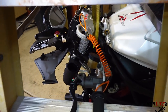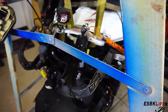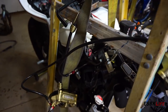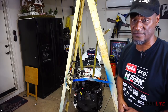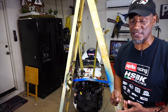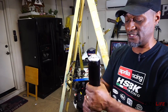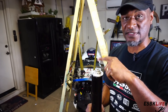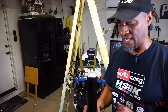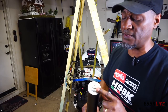As you can see, the forks and everything are already off the bike — the clip-ons, wheels, tires, all of that is out of the way. You remove the front wheel and everything attached to the forks, then simply slide the forks out once you loosen them from the top and the bottom of the triple tree. Now there are a couple of nuances: before you remove the forks from the bike you want to loosen the fork cap, because it's really hard to do without something to hold it in place, and a vise will mar these. Also take out all the preload and the rebound.